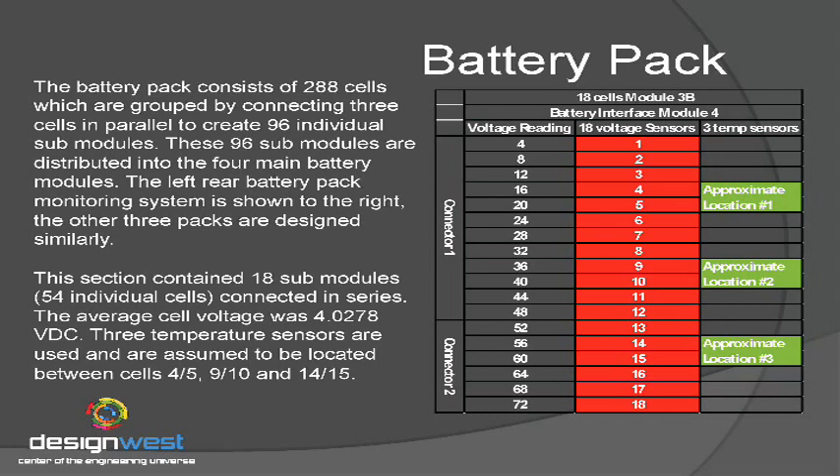In addition to monitoring voltage, they're also monitoring the temperature of the battery pack, because temperature is very critical to the life expectancy of this battery. You've got to have a controlled temperature — if it runs too cold or too hot, it's going to degrade over time. I don't think GM wants to pay warranty costs before the end of the 10-year warranty they claim. The voltage sensors are spread out approximately every four cells within the battery pack.